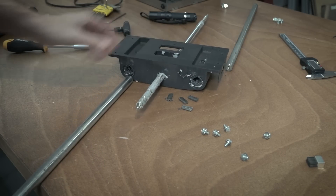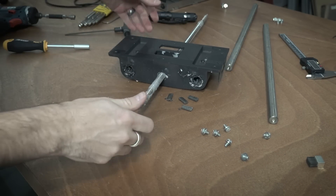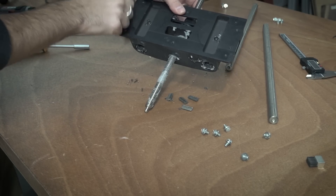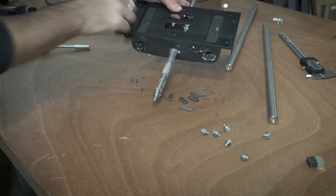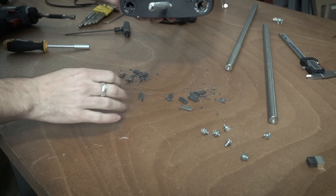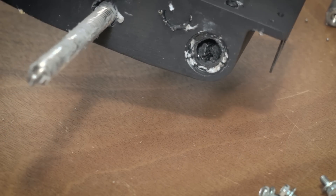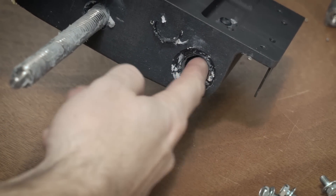The service manual specifically talks about how if you're going to remove the rod from this bearing assembly, you need to have some kind of spacer inside or else the ball bearings are going to go everywhere — it's not a fully contained bearing. I didn't care because the bearings were shot anyway and when I removed the rods you could see just how disintegrated and torn up the bearings were.